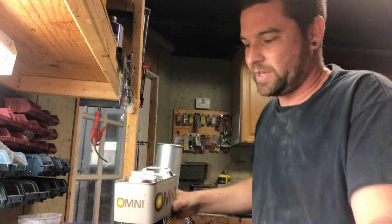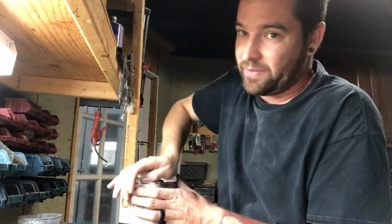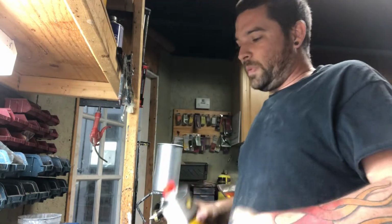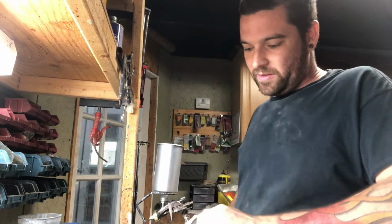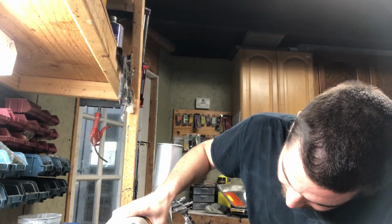All right, that gets you to the 3.5. Next part is going to be your hardener. This does not get reducer in this stuff either. So we're going to take our hardener, 1 part hardener. Since I'm using ounces as a part, 1 ounce is 1 part in my ratio of what I've come up with. We're going to go to 4.5 ounces because we're currently at 3.5 ounces.